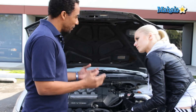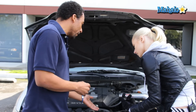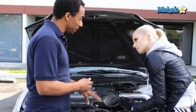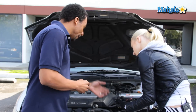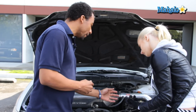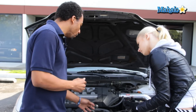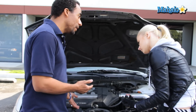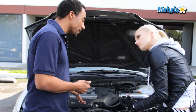There's extended life OAT, there's hybrid OAT, and North American green. You don't want to put the wrong antifreeze or wrong coolant in your car. Now, you notice that your levels are okay, so we don't need to add any, but if we did, the reason why you don't want to ever run low on coolant is because your engine could overheat and you can crack your head or blow a head gasket.